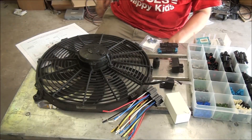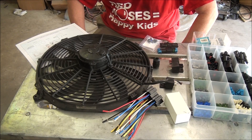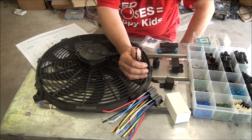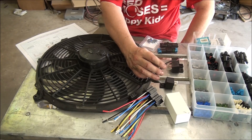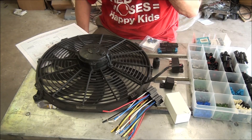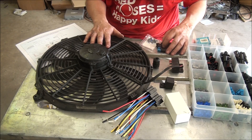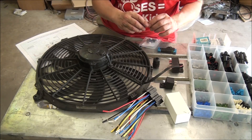This is a little bit of what's going to go into the wiring on this car, particularly in the HVAC unit and the radiator cooling fan. When they had installed the fan originally they had hardwired it in, so to get the fan out I had to cut the wires. One of the things I'll be doing is using a quick connect so that any future servicing of the fan can be taken care of rather easily. I will either be using a weather pack or a metro pack connection. As the name weather pack implies, it is weatherproof.